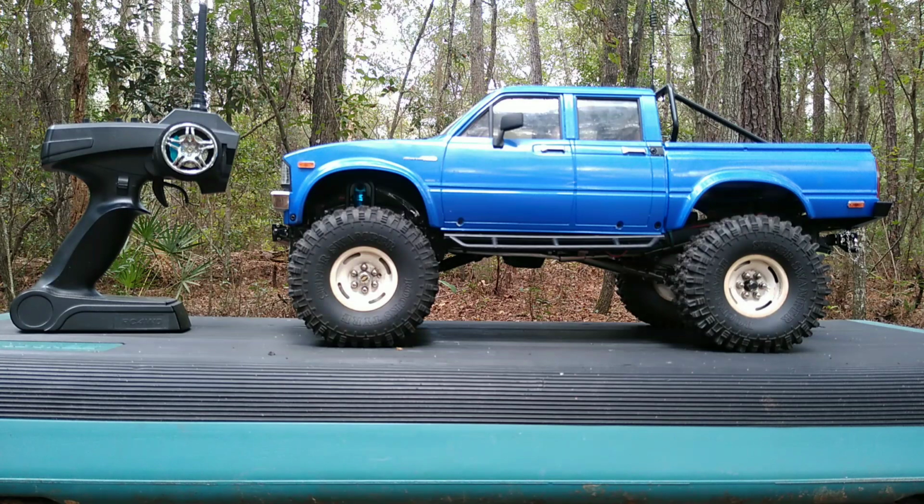Now on the hitch mount, the original brackets for the hitch mount would not work with this setup, so I made my own out of some 1/8 by 3/4 flat stock aluminum in order to bring the hitch up to where it needed to be. And I also flipped the hitch mount itself upside down, which put the hitch in the ideal location.